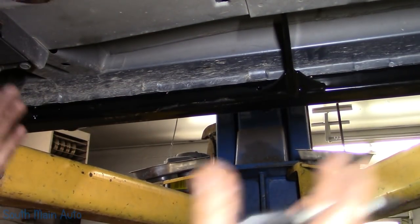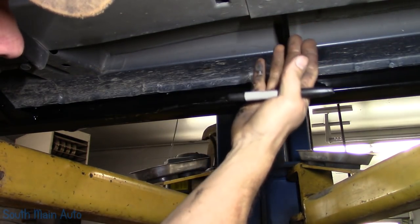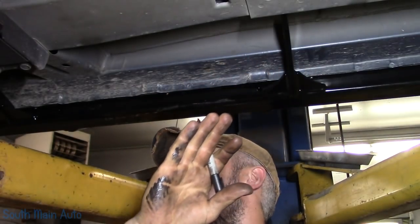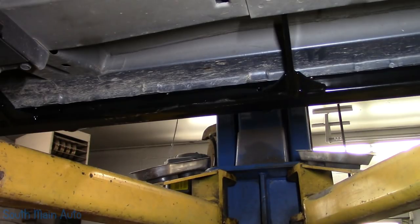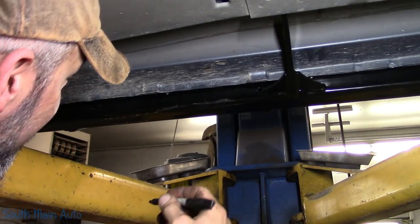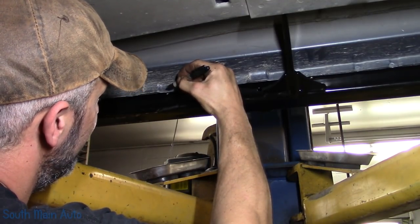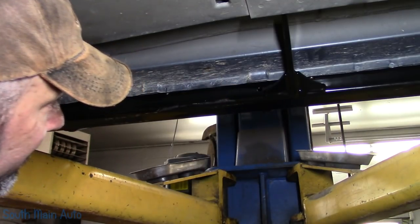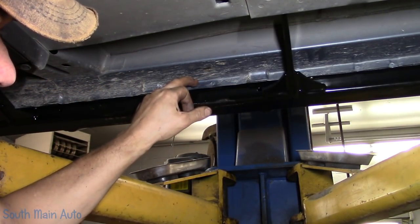Once you determine where you want it, I looked at the braces that come out to the unibody, to make sure they're gonna line up in spots that aren't gonna cause any problems, like overlapping metals. It seemed to be okay. So I've set it back down, and like I said, they've pre-drilled the holes. So we just have to go through. I'm just gonna take a Sharpie and mark these, and then what they say in the directions is to measure down from the corner of the lip.